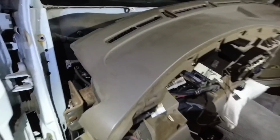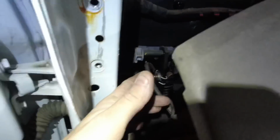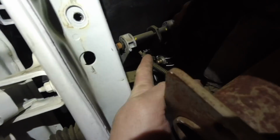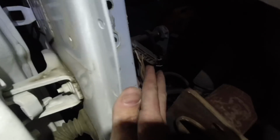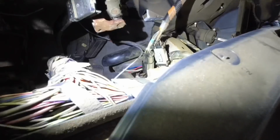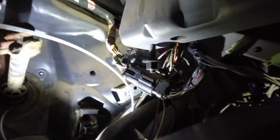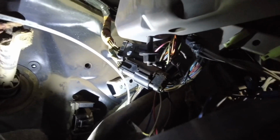And there's 2 more plugs that, if you have, for example, a clutch truck, then there's a cable that goes right here to the clutch pedal. That needs to be unplugged right there. So we got that one right there that plugs to the clutch pedal, and 2 more right there, if you guys can see that, and that goes to the firewall harness. Here you can see that it goes to the firewall, so there's 2 plugs right here.